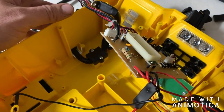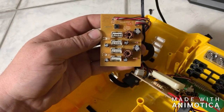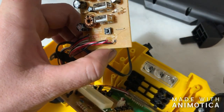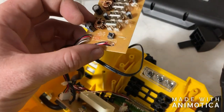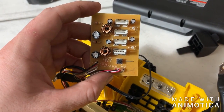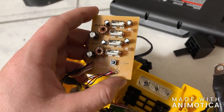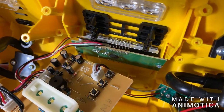That resistor will help keep the electrolyte from boiling off so the battery doesn't get too hot and the voltage doesn't get too high. This is the little USB charger board, and I have to say I'm not real impressed with their use of hot glue here — it would have been nice to see something better than that. Since this thing's going to be in your car and flopping around, something might break there over time. It's pretty basic, just converting 12 volts from the battery down to 5 volts. It also has a pressure sensor for the compressor and an LCD screen board.